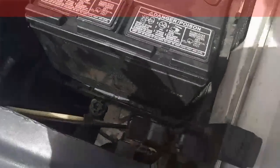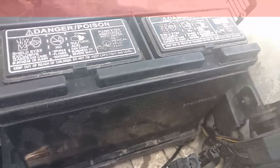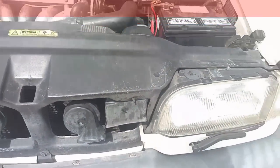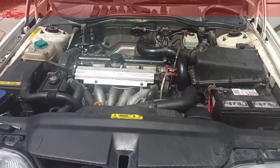When I started the car, I could hear what sounded like a vacuum leak from over here by the battery. So I pulled the battery and the tray, and the line going to the cruise control had a splice in it — not sure if that was separated, but I did fix that. The turbo boost control valve was torn off of the air box, and the duct attached with that little rubber plug was displaced. I fixed that. I still need to finish the AC, then I'll be all done here.